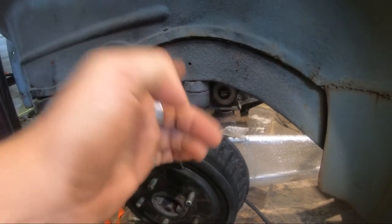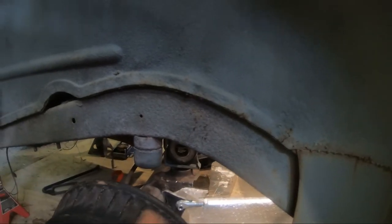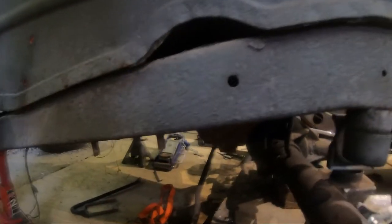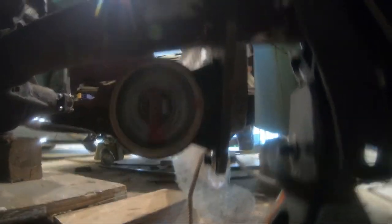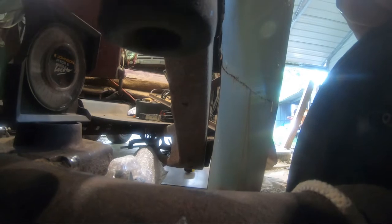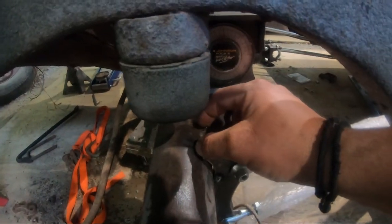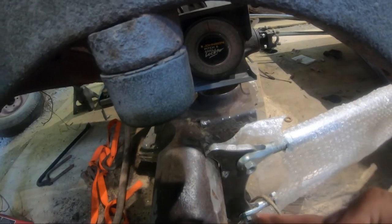The axle this way is kind of level. The spring perch is pretty much level, which gets our pinion up two and a half to three degrees, which is what I think I want. And back here, our little bracket tree is now level. We're headed straight over to our other front-end bracket. That little bracket is a little bit out of line, but I haven't made the bracket to hold the bracket yet. If we want to straighten that out so that we're in the middle of our rotation on our heim joint, we can do that if it's necessary.